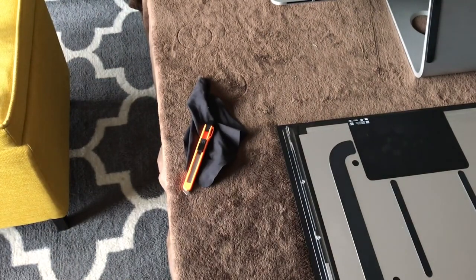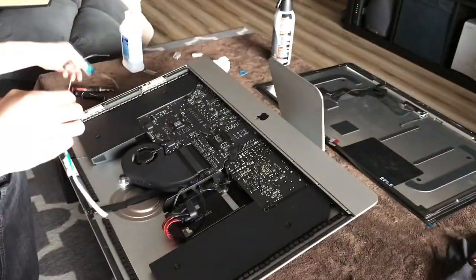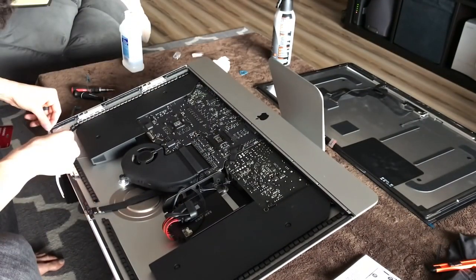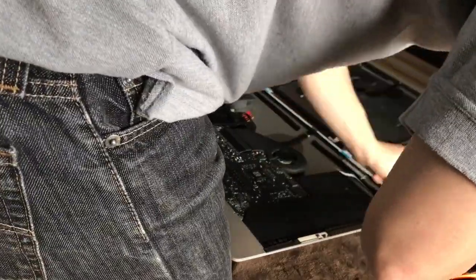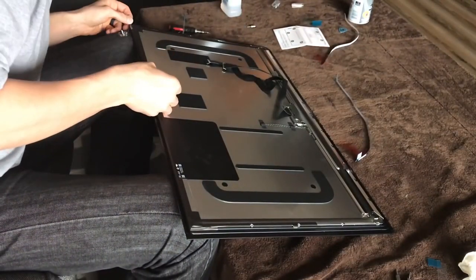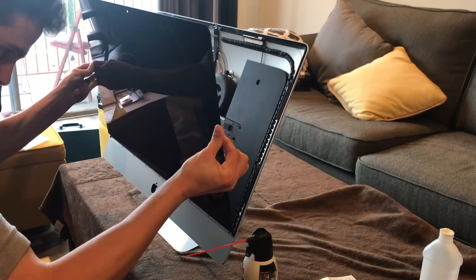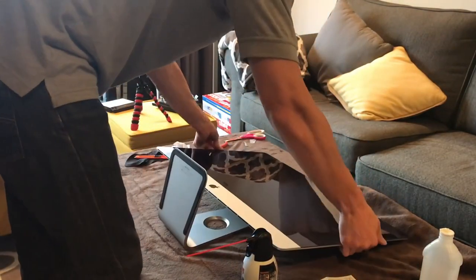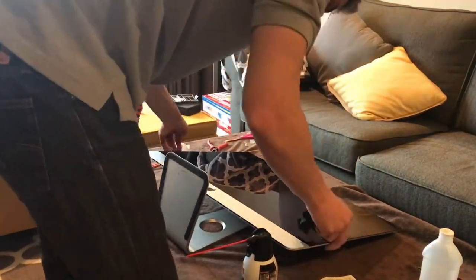Now it's time to reseal. Grab your numbered adhesives — as you can see from the diagram, they're numbered 16, 11, 12, 15, 14 — just follow that diagram to reseal. Apply the adhesive to the frame first, unpeel one side and stick it on. Having the adhesives labeled makes it really easy. Then apply adhesive to the monitor as well. Once all adhesive is applied, remove the other side and carefully line everything up — you might need a second hand because once it's on you can't peel it off. Plug everything back in, lay it down, and press around the sides using a microfiber cloth.